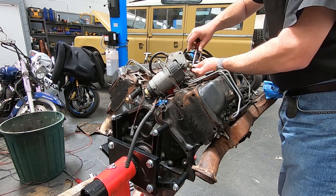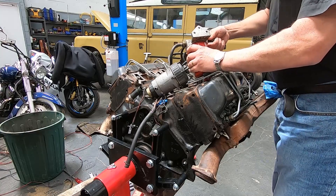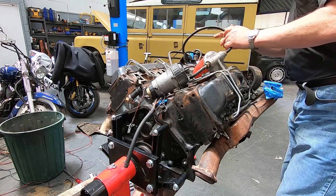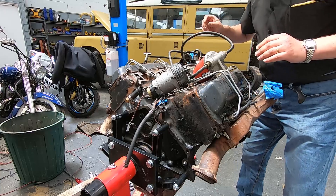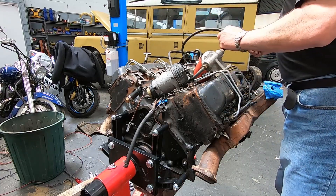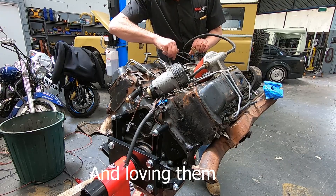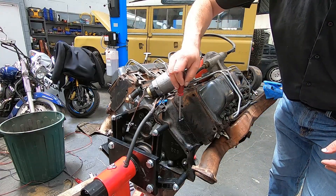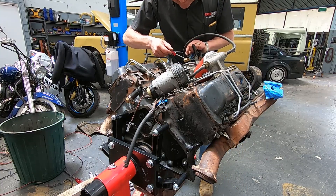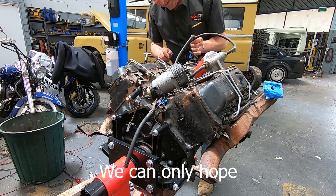I'm starting with this extra fuel filter. While I'm doing this, let me say I am really concerned about what we're going to find when we open this engine up. Because when I was turning it over to undo the torque converter, it seemed to have really low compression — it was just far too easy to turn over. And I think you may be able to see that's part of the head gasket sticking out of the block. So at some point that's just gone bang, right out of the block. So far it's not telling a good story, but we're going to persevere until we know exactly what we're dealing with.